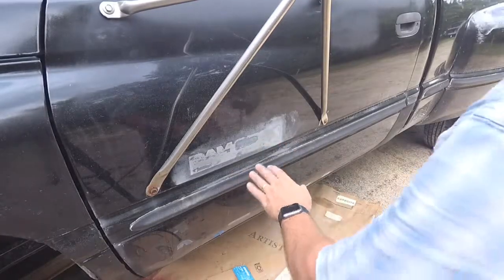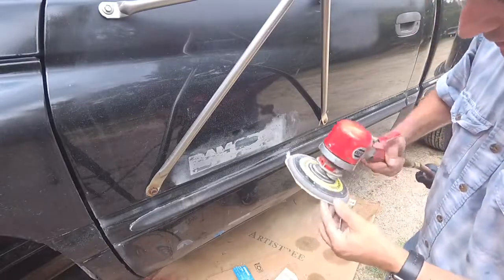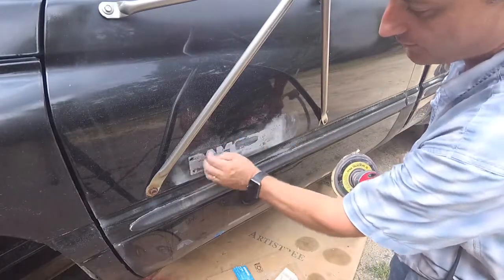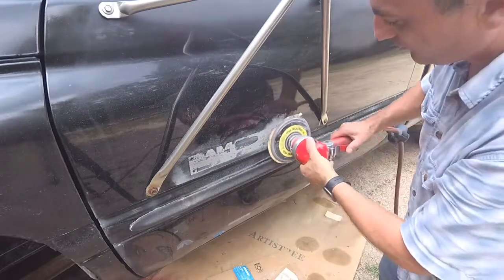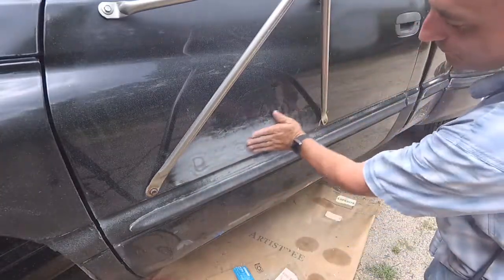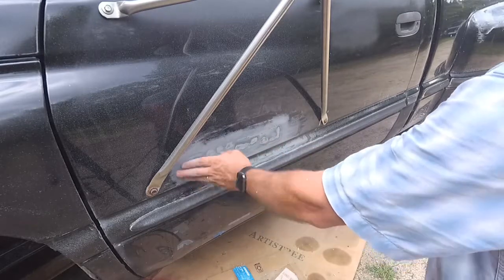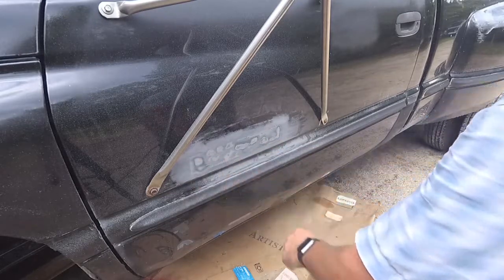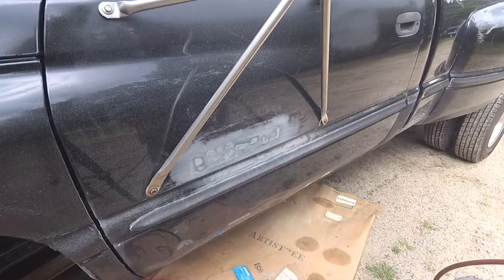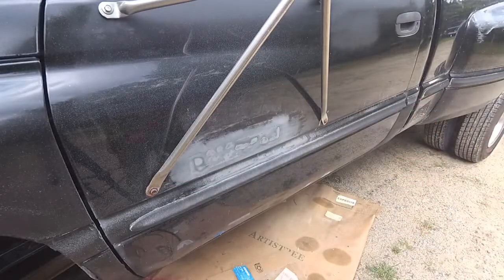I did get as much as I possibly could scraped off. Now I'm going to employ an orbital sander just to get the rest of it off. I've got a pretty coarse one on here — I think it's about 80 grit. I don't want to go too much because I don't want to get into all of this, but I do want to get this off because it's going to show up really bad. It's actually going right down to the metal in many spots, and there's still residue. I'm just going to have to really get that cleaned up and sacrifice a little bit of the paint in this area. I've got to sand it down anyway, so I'm just going to finish it with this. I'm going to do the whole side of the truck with a much finer grit before we spray it anyway, but that's for another whole video.